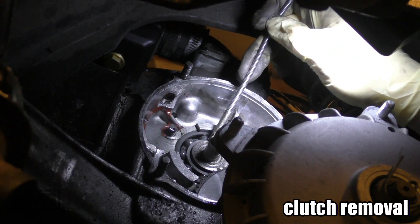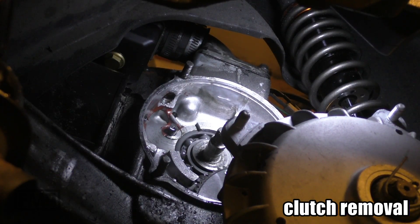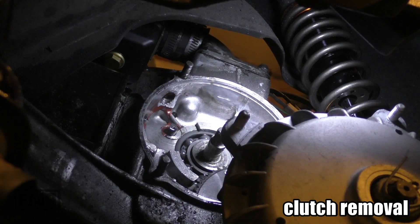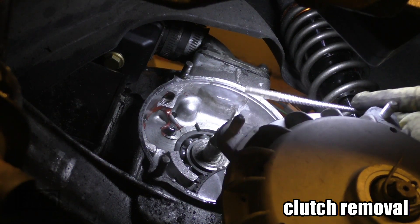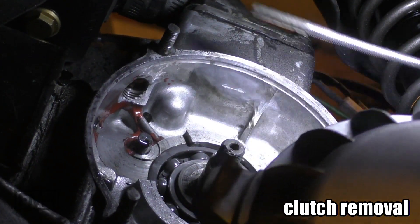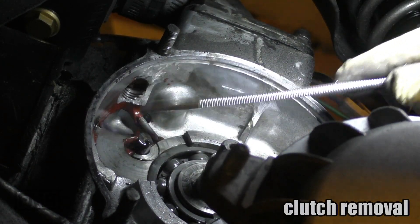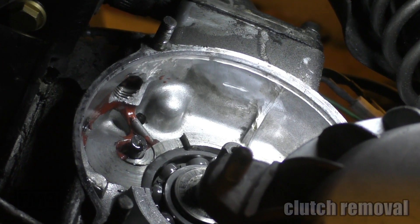I'm gonna remove this one — you saw — because with the Quattrini crank it's a little bit loose, I don't like that, but it is how it is. Also check the wear marks — it's still okay. And as you can see here, I used the good old thicker washer underneath the clutch, without the sprocket for the oil pump — so no teeth here for this oil pump sprocket. This one is stronger than the other one, because the other one can sometimes break and crack. It's hardened, and that's not what we need — hardened metal parts in the engine case, in the gearbox.